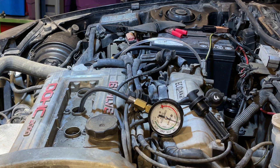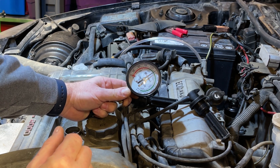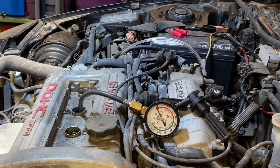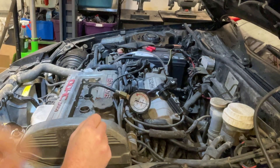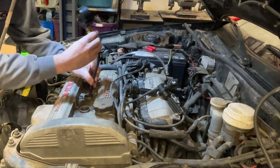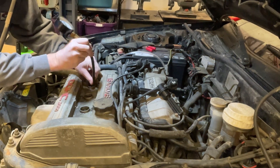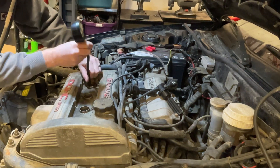That one's a little low — about 145. Remember I said 5 or 10 differential is not ideal. I'm going to do it again before I do anything, just to see. Yeah, we got about 145 on that one. What I'm going to do is put a little bit of oil drops in there. If I put oil in it and it comes up to where it needs to be, then it could be the rings are a little soft or not quite sealing properly. I don't know if I'd worry about 145, but I want to identify exactly where the issue is — and the leak down test will help too.